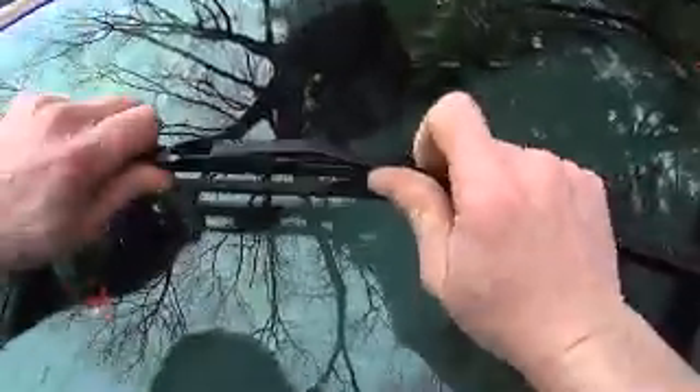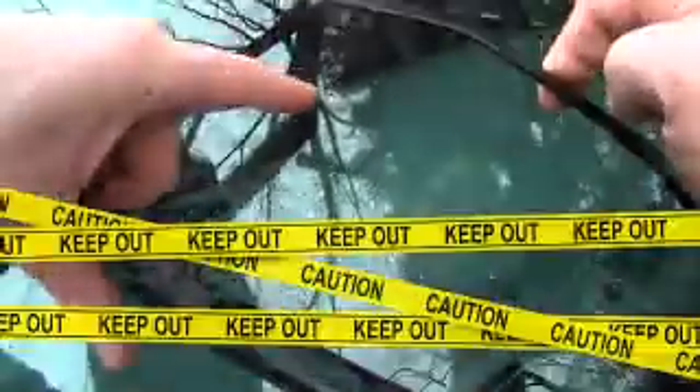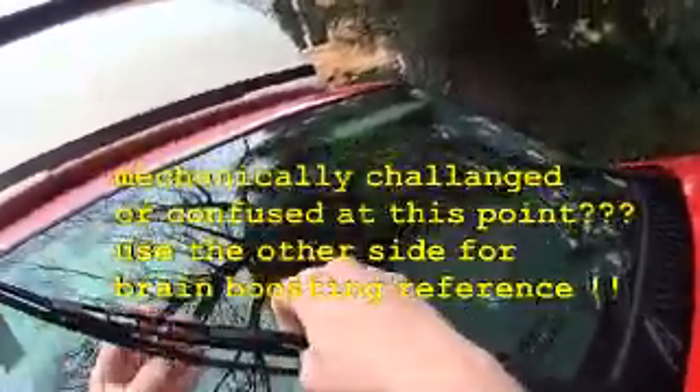Pick up the wiper arm and push in the clip — you see that round clip. Now be careful: it's spring-loaded. If I let this go right now, I'd crack my windshield, so put it down gently. That's the one thing I want you to be careful about. You see it just slipped in to that chalk. Then we take the new one, match it up with the chalk in the same position. I tilt it up and dip it in because it's got to fit right in there, then push until it clicks. That wiper blade is installed.